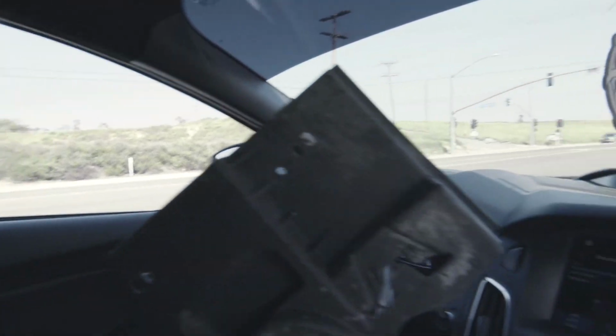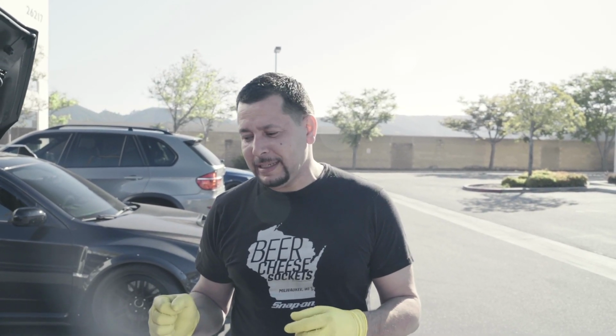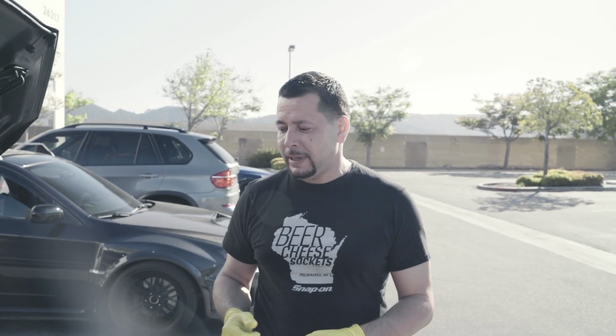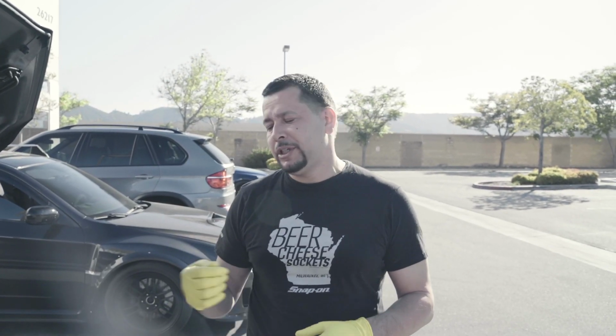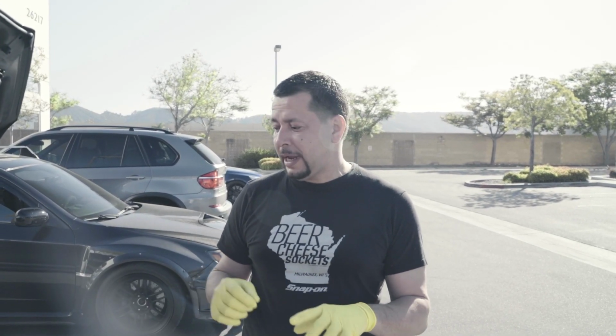Yes, sir. Hey, everyone, Junior over here at Nobody Performance. As we were working on Mikey's car, we thought we had an issue with the clutches slipping inside the transmission because it was getting to about 6,500, 6,000 RPM. It felt like it was slipping, but at the same time sounded like a sputter. We came back to the shop and started checking the fluid on the transmission.